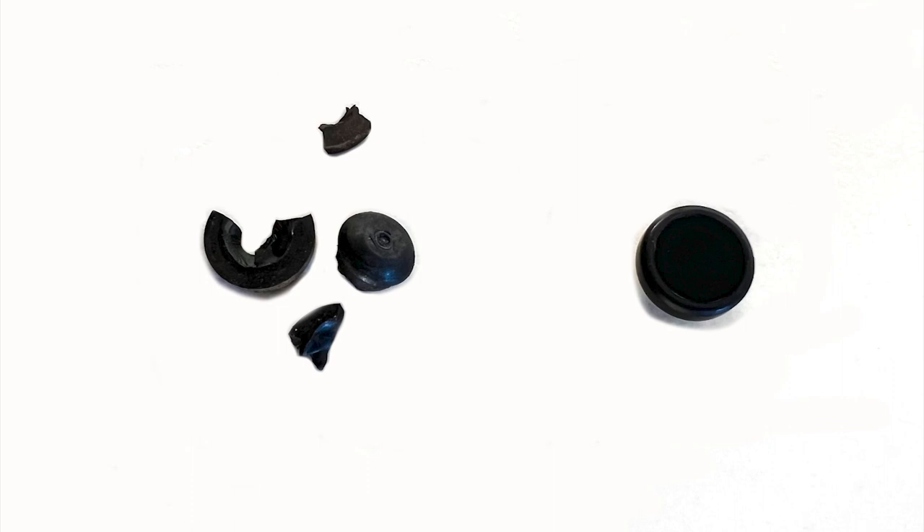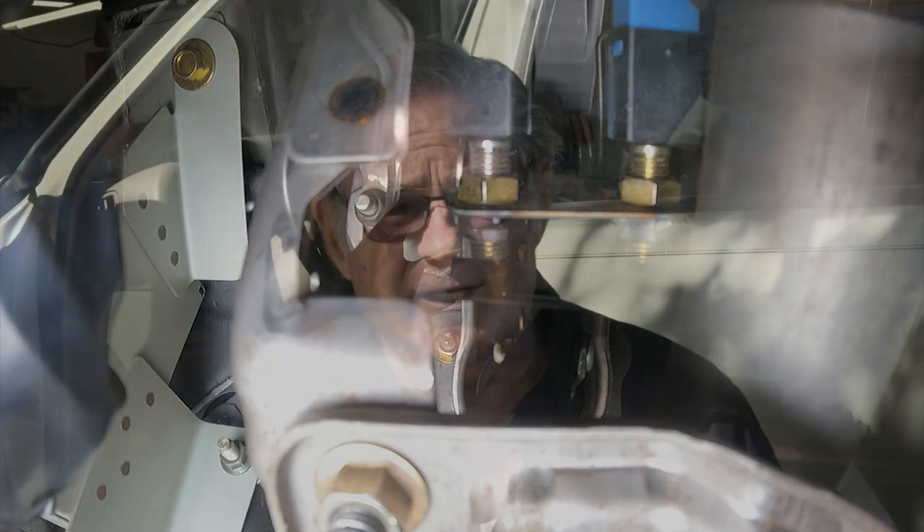So if all of a sudden your cruise control goes out, or if your brake lights come on and don't go off, one of the items that could well be the cause is the little grommet that pushes on the brake switch or the clutch switch if you have one. The Pathfinder happens to be kind of unique — they have a broad plate attached to the brake on the automatic transmission versions that has both the clutch switch and the brake switch. When you push on the brake pedal, it engages both switches. Well, the grommet on the clutch switch disappeared — it shredded, disintegrated, and fell out — and that was the problem.